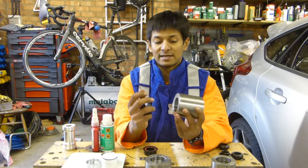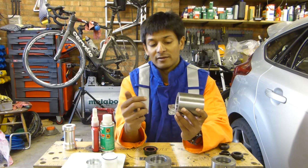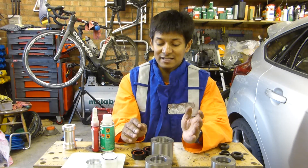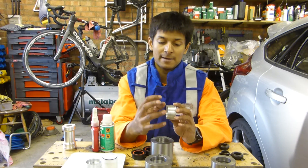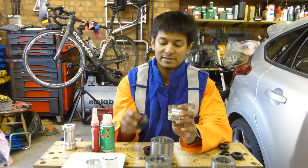The alignment between the drive side and the non-drive side — Cervelo, I think, use one drilling motion from one side straight through to the other. However, some people still have creak. What causes it? The same thing as everything else really: an improper fit or improper alignment between the drive side, non-drive side and the ball bearings themselves.